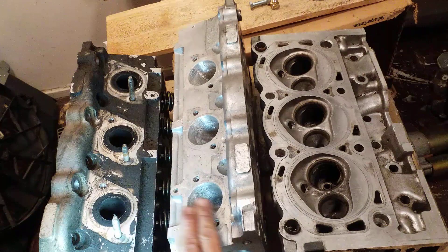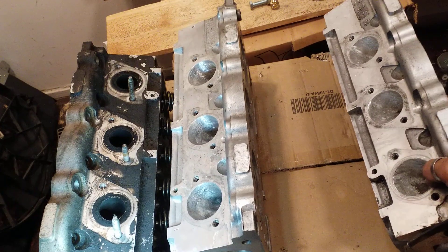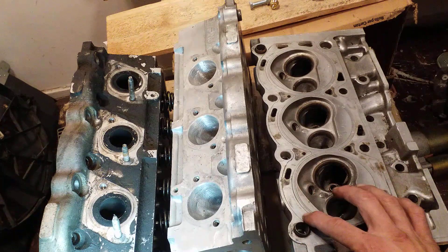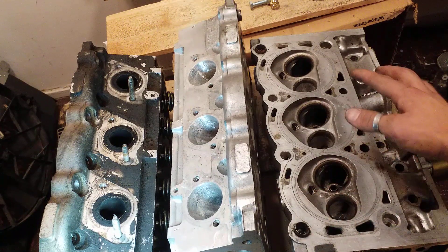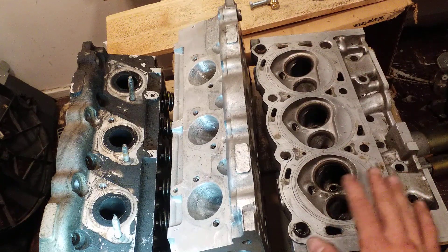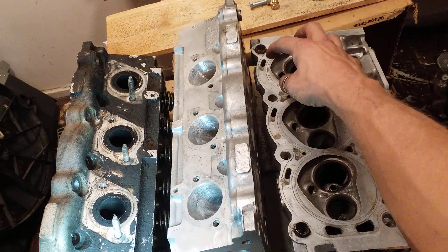This is also what goes on and why it kills engines. On this one, you're going to see that the exhaust port is right here, and on the intake side of the head over here, it comes in real good. But there are a few different places that have no coolant flow through on the head. You're going to notice that there's only holes here, here, here, here, here, and here on the outside lip — the rims and edges have two and two. If you see four-cylinder, four-valve, or LS engines, you're going to notice they have full flowing heads. So there's going to be another port right here, right here, right here, and right here so that your head has the ability to flow coolant in and out.